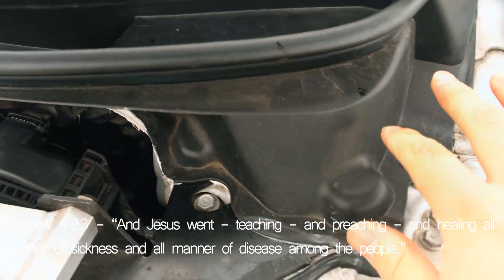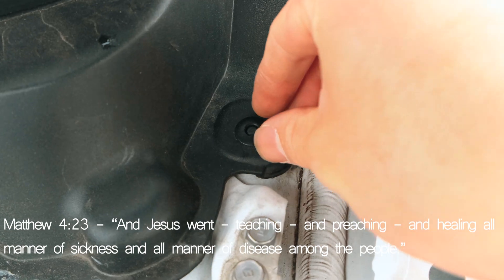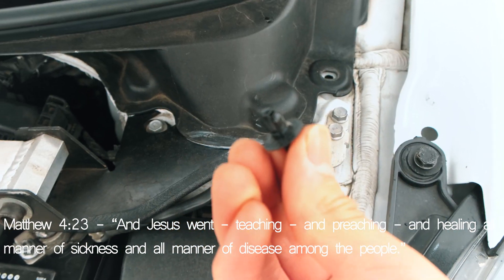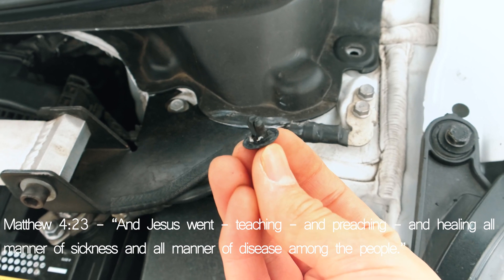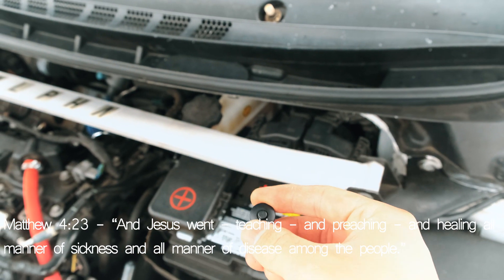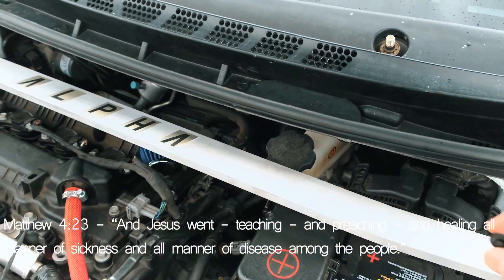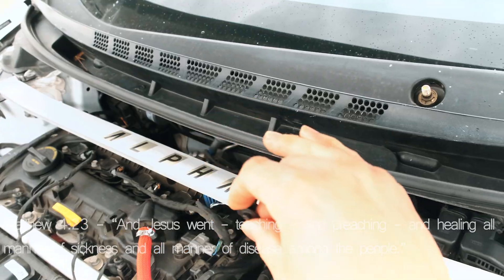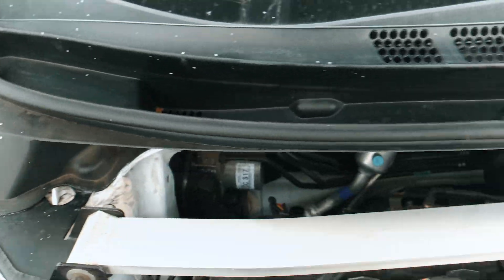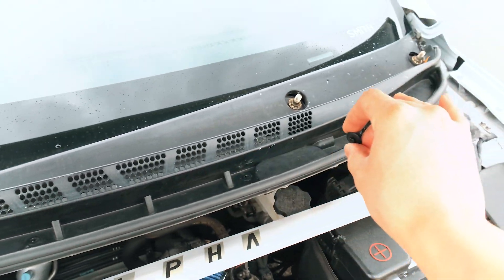It's really simple. After that, you're going to have four of these clips along the car. Essentially you just push the little button or dimple in the middle, and that'll let you get a grip on the side to pull it out — there's your little catch assembly. These have a tendency to fail over time because they're plastic. The middle plunger will fall through when you push it. For the middle ones — be careful they don't drop into the engine bay. Make sure the two middle ones are handled carefully. You still have the same thing on the other side, so it's four total.